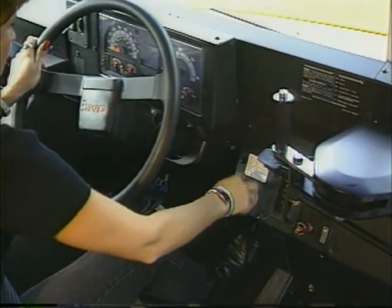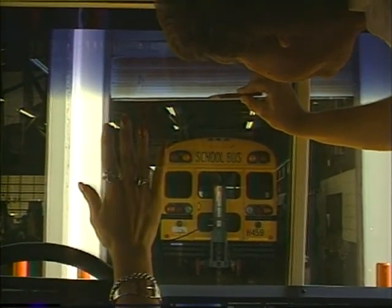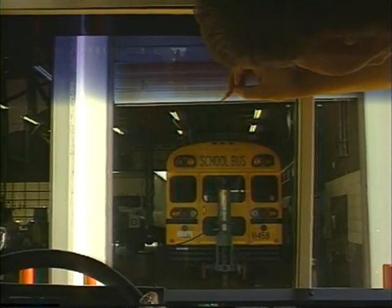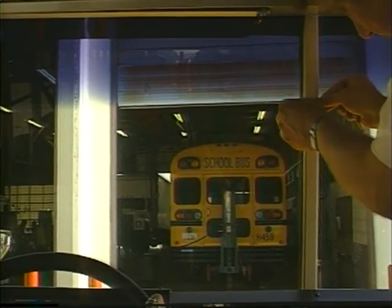Sitting with your seat properly adjusted and your safety belt on, line up your over-the-hood reference point with the base of the overhead obstruction. Secure your bus. Now have someone move a pen or pencil down the windshield, stopping when the pen and the overhead obstruction line up in your view. Mark this spot. A small piece of tape on the windshield post will work fine as a permanent record.